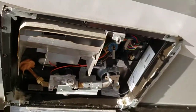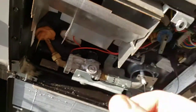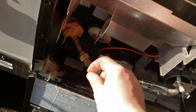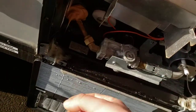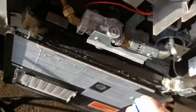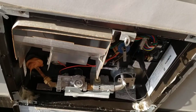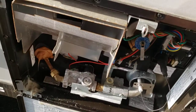Water heater — super simple. The only thing you need to do when you get this is put your plug in the drain. 15/16ths is the socket size. Use a short socket with an extension and a ratcheting wrench, get it threaded by hand, then tighten it with your wrench. Don't over-tighten it because it has plastic threads. Once it's plugged, you can fill it with water from the pump or city water and you'll be good to go.